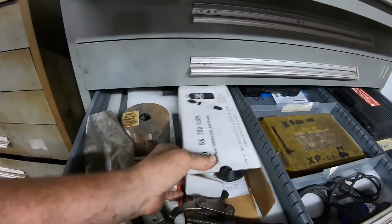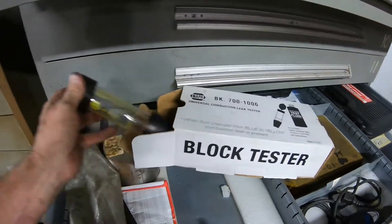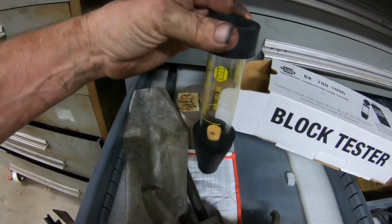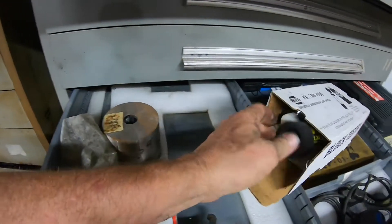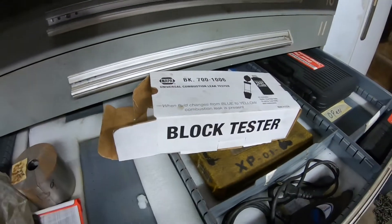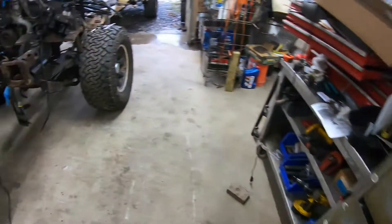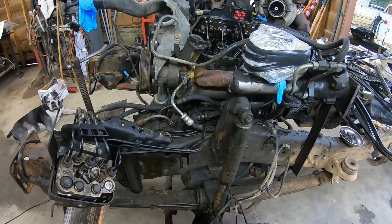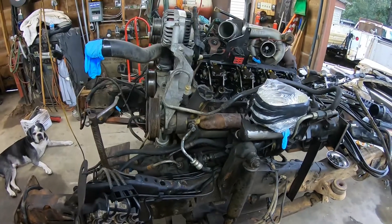That's not steam — if it was steam, given to the pressure, that hose would be hot. If the hose is hard and cold, it's combustion gases. I do have a test kit right here. You put the blue fluid in there, stick this over the radiator, and it'll bubble. If it's got any kind of pressure on it, it'll bubble and that green will change — it says it goes from blue to yellow, but it really turns green.